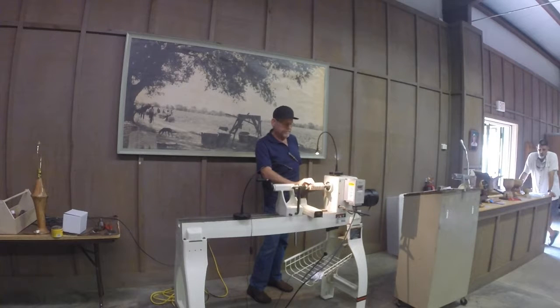But like I said, on the mix and color, what I do is use so many drops. I use a medicine dropper for X amount of filler. Now, if you're going to use body filler and you mix the color with it, it's going to thin it down. It'll take a little longer to dry than it normally does.